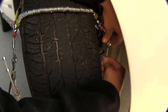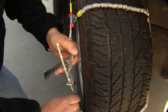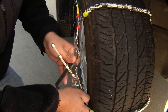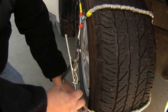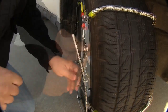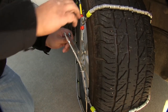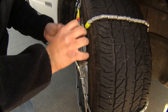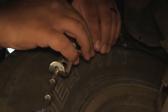There are a series of stops on the inboard and outboard side. We do need to make sure that the stops are within one of each other. If not, the chains won't fit properly and could cause damage to the tire or vehicle and reduce traction results. With both ends of the chains secured by their stops through the keyholes, we'll then take our cam lever and pull it over. This will help to tighten the chain around the tire. We'll secure the cam lever to the side of the chain and then use the plastic hooks to secure our excess stops.